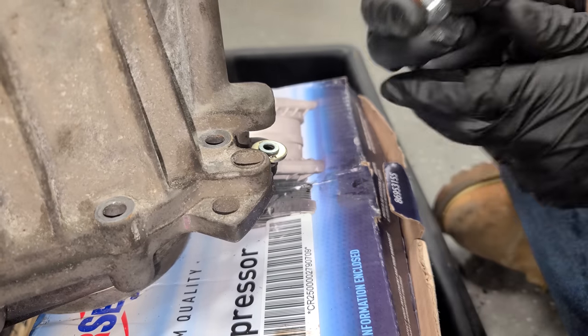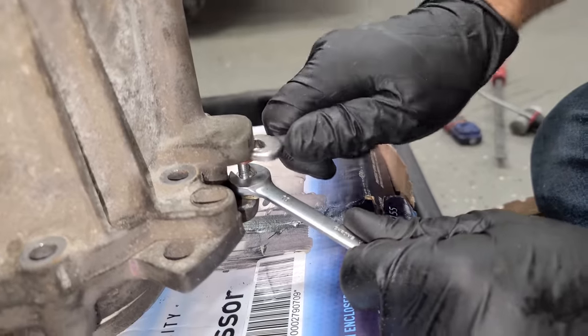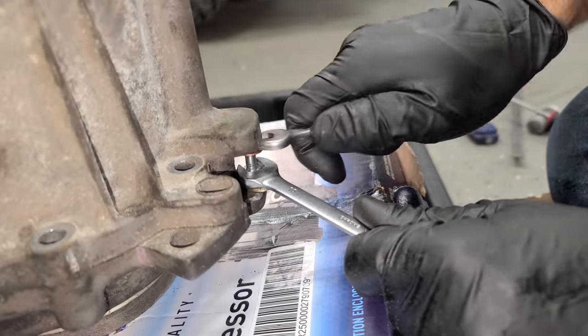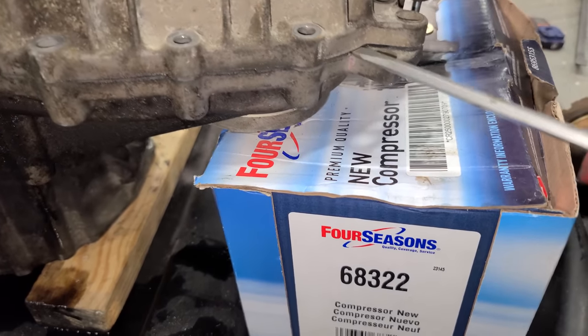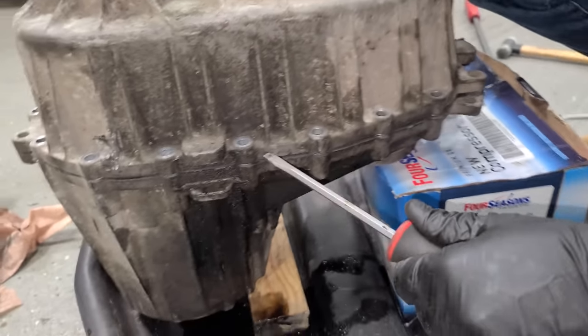Okay, if you need to get a washer in here, you can do that. Now this will be the perfect height to pop this up. Okay, so now we're gonna loosen this up, which is going to elongate it, and now it's a bottle jack. It should be able to separate these two. Yep, it's coming, see? And you can start to see some air in there. Now that we have that, we can get a little screwdriver in here, and we can start to pry it. Cool. There we go. And we'll just go evenly all the way around.